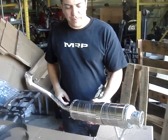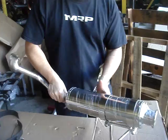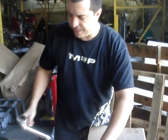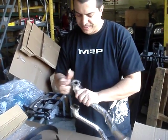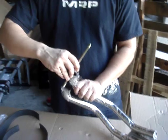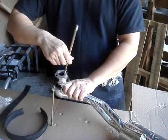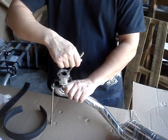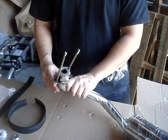If it's a private label brand, you might have to bend it a little to get it in there, but once it's in, it's good. That's for the 150. Now, I want to show you the difference between a GY6C and a GY6A: when you connect it to the cylinder, in no way is a GY6C going to work on a GY6A. The headers are completely different.